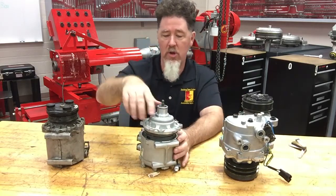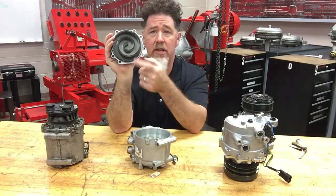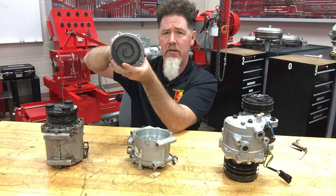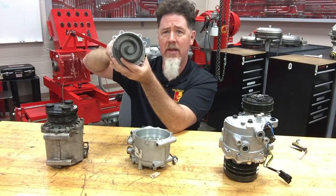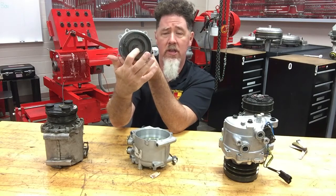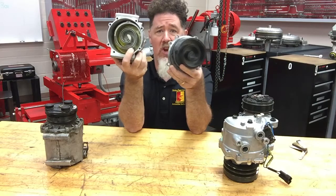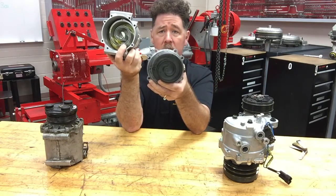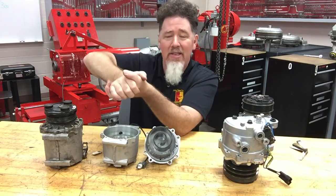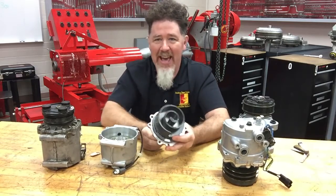I have this one here which we do have a part for. When you undo those eight bolts and pull it apart, you have two scrolls — a movable scroll that is connected to your input shaft, and as you move the input shaft that scroll doesn't rotate, it oscillates. As it rotates it takes refrigerant from the outside and pushes it around until it hits the very center, which is the discharge outlet. You have a fixed scroll in the housing that's stationary, and the movable scroll connected to the input shaft. You're squeezing that refrigerant — like cupping your hands in a pool and squirting water — squeezing refrigerant from the outside all the way to the inside.